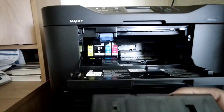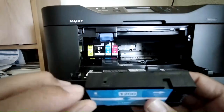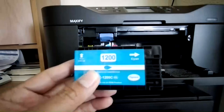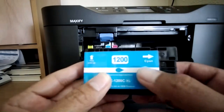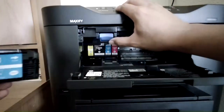If you notice, there's just a little hole. With a remanufactured cartridge, they usually dry up if you don't use your printer often. So if you don't use your printer often, it's better for you to buy the manufacturer's cartridge because those will last longer.